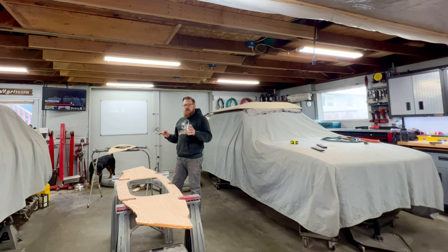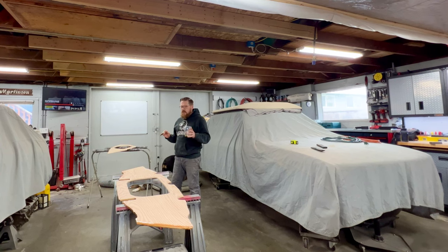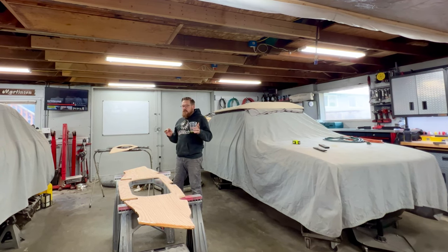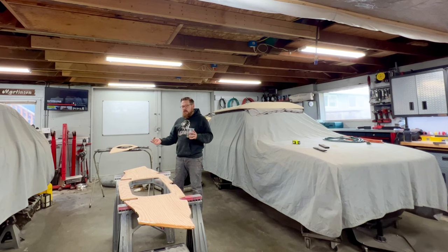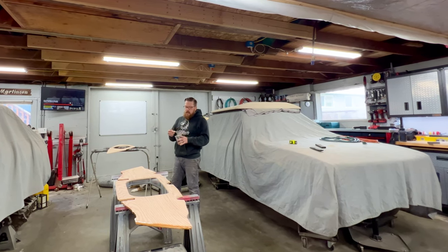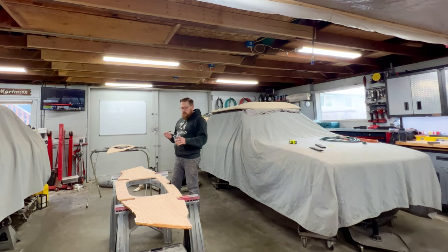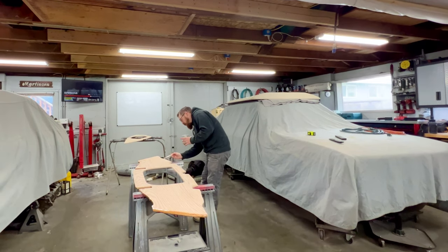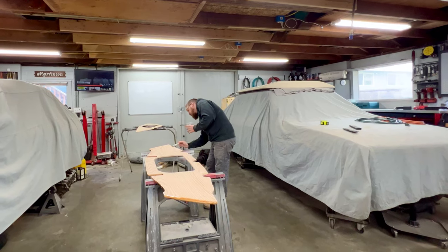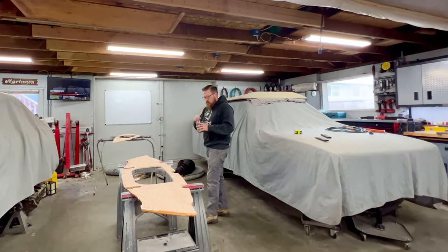What I figured is I could go ahead and drop down to the half inch plywood again because of the weight versus strength, but by doing so I could buy two sheets of plywood, which I was going to need anyways, and I could rip it at 26 inches on one side, and the other side's 22 inches. The 26 inch side was, again, those two pieces are the floor. I cut both of these bulkheads out of the remnants of that because they're no taller than 22 inches. So in the end, it ended up requiring the same amount of plywood by doing this versus if I were to keep my stringers at 24 inches.